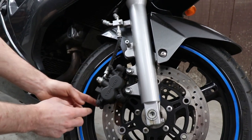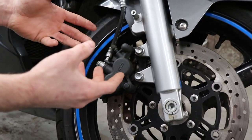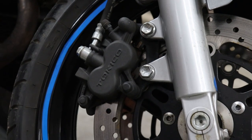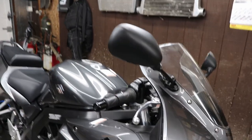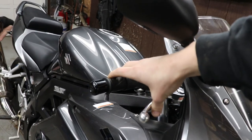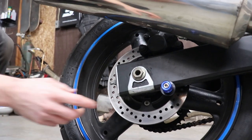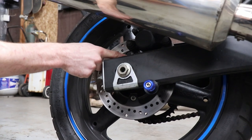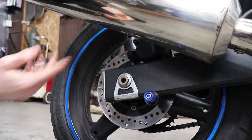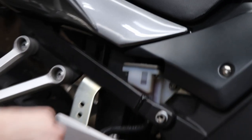That's fairly straightforward: remove the two bolts, take the caliper off, remove the brake pads. There is a pin right here that you have to take off before you pull the pads off. You pull the pin, take the brake pads off, retract the caliper, and put it all back on. And like a car, but instead of the brake pedal you've got your lever. This is a hydraulic system — you pump this. And we also take the center bolt off right here, remove the chain, then pull the tire off. By removing the center bolt we can take this bracket off, which then the caliper comes off. This has a separate reservoir right here — as you can see it's low, brake pads are low — and then we're gonna prime the system since the fluid's old and probably degraded, which is why I brought more fluid.